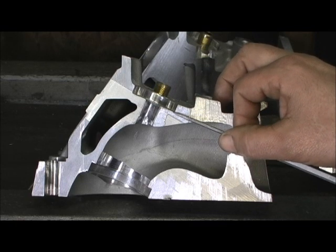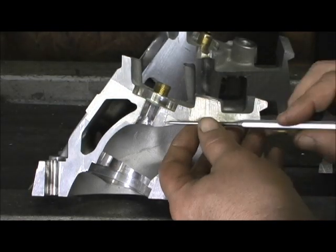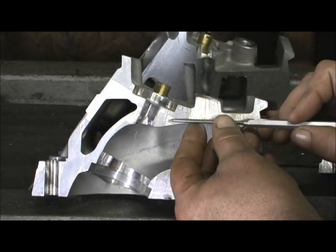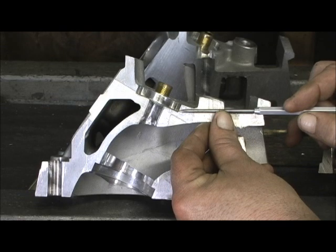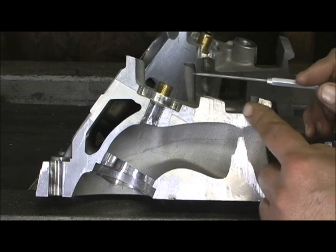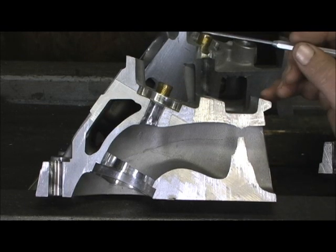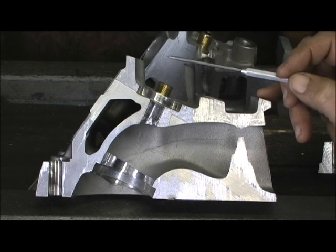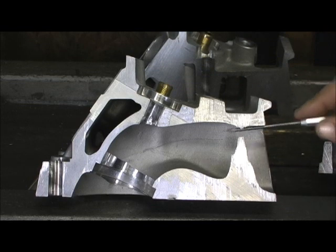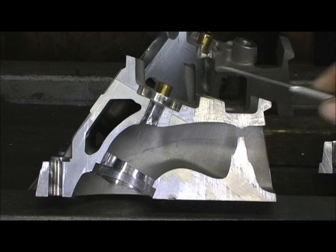This is your danger point right here on a 23-degree head, because when you begin the cut and you're going to have to leave the support for the guide, you're going to come up, and look at this — going straight is going to get you almost level with the top. Now, when you're shaping it, remember we're not going all the way there, then you'd have to put epoxy in the bottom, raise the bottom up, and start turning it into a 200-thousandths raised runner head.